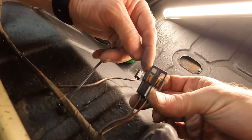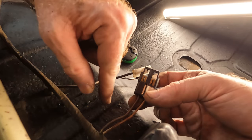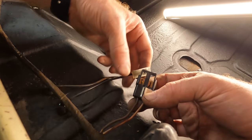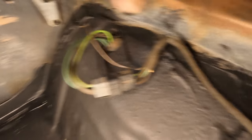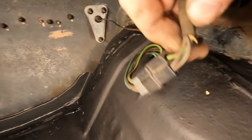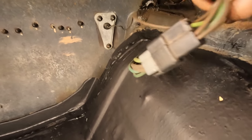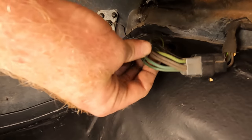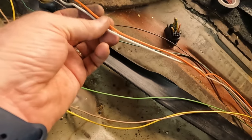One thing I did want to note for myself is it looks like there are five wires going in, and then there's one breaking off for the parking light. There are four going in: two brown, a lighter green, and a darker green. Coming out: two green, two brown, and a lighter green. From the old wiring, the one I thought was tan is actually white because it's been buried for years. So the white and the orange/tan led to this piece here — there's an orange one in there together. This was the connection for my door jamb and the headlight switch to turn the dome light on and off.